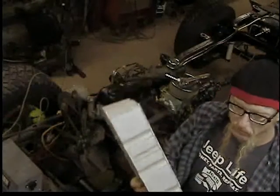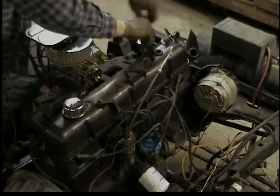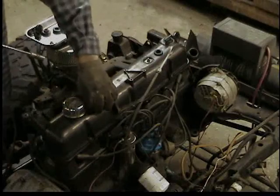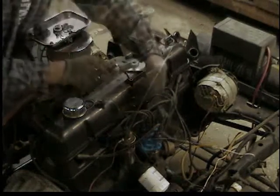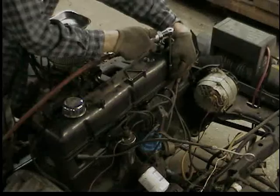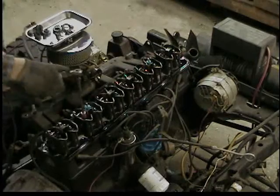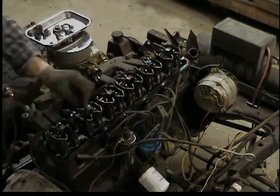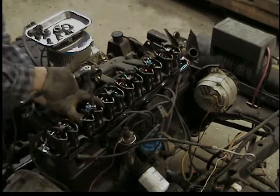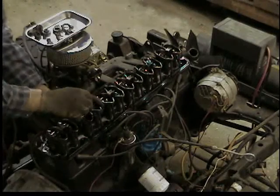We'll start by buzzing off the old valve cover. Remove the five nuts down the driver's side, two nuts out of the center that go down to some rocker arm bridges, and then there are three up on the passenger side — one on each end — and it pulls off. Then we have to replace the rocker arm bridges, at least the two of them that had studs sticking up for the old plastic valve cover. The kit supplies two new un-studded rocker arm bridges.